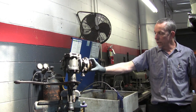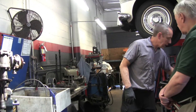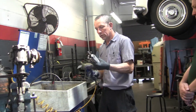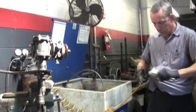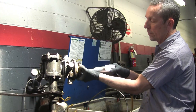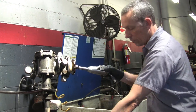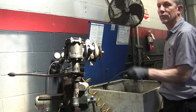This gear on the end is held on with a tapered shaft. I'm using my little butterfly gun. We'll take out the bolt on the end — and it's got fluid in it. There's an O-ring inside the shaft that has gone bad, and that's why this is full of fluid.